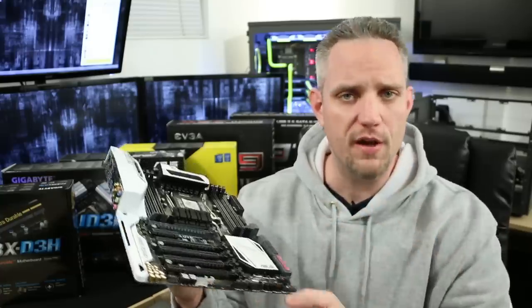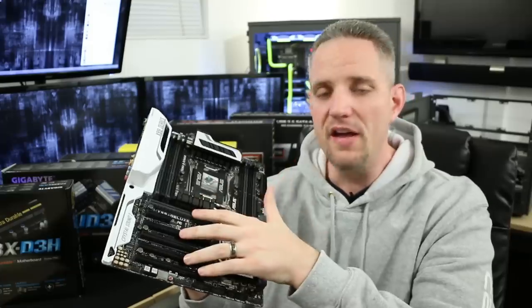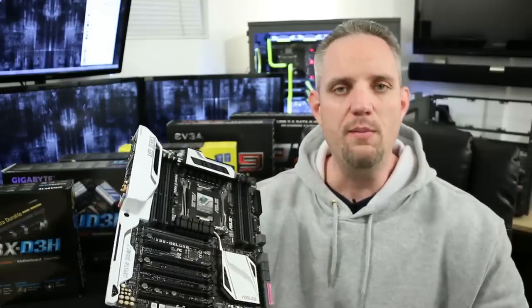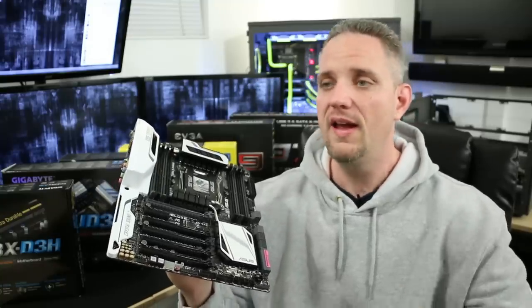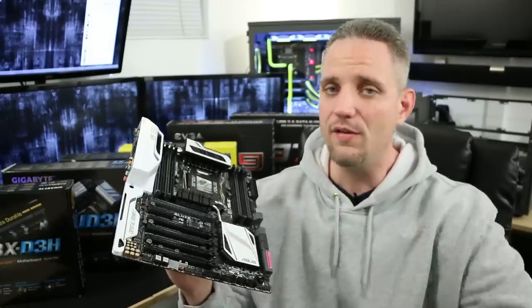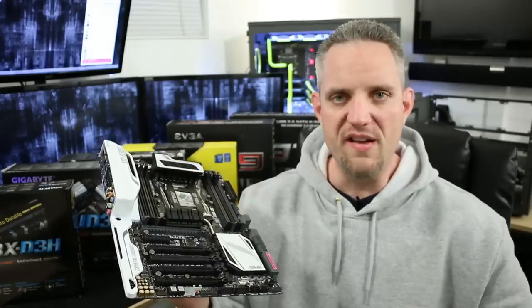Here's the real kicker: most of the time when you run an SLI or Crossfire config, the slot is going to downgrade to 8x anyway. The system behind me — Skunk Works — has three GTX 980s running at 8x, 8x, 16x. One card is 16x and the other two downscaled to 8x. Did that lower my scores and FPS? Absolutely not.